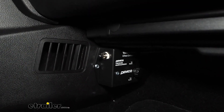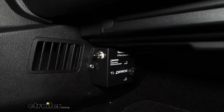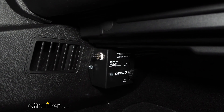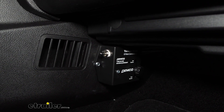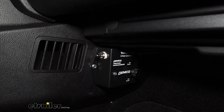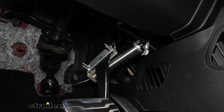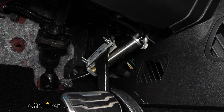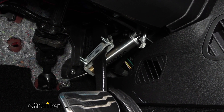Mounted on the passenger side is our G-Force controller. It has wires coming off of it and is an inertia switch — it has a mercury switch that allows it to slow or stop accordingly, making the system proportional. It also has a toggle switch to turn the system on and off, so when you're normally driving you can switch that off. The vehicle is slowed and stopped by use of a cylinder mounted on the brake pedal, anchored to the firewall with self-tapping screws — this is where the airline from the main unit feeds into.